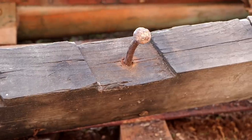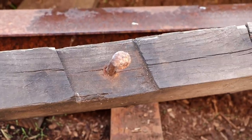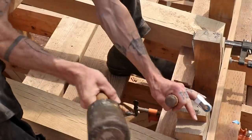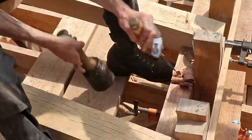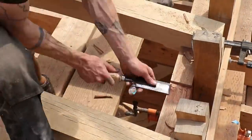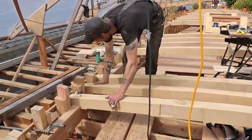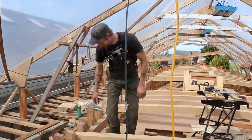As you can see from the original beam shelf, it was only the king beams that were originally dovetailed into it. The few standard beams and all the half beams were just notched into the beam shelf with a simple lap. There's not a lot of overlap with these beams, so there's really not much point cutting a dovetail. It would be such a small surface area that it wouldn't really be doing very much. Way quicker. Yeah.